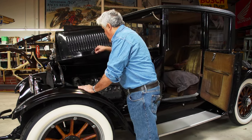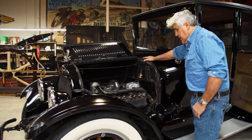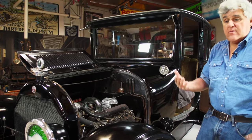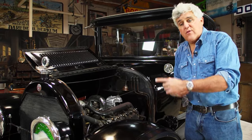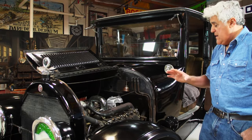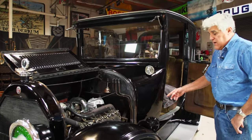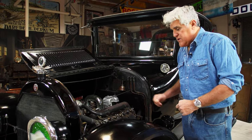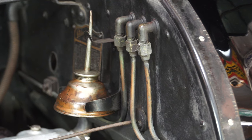Let's take a look at the engine. It is a beautifully manufactured V8 — it looks a little rough because it has not been restored. It has detachable heads, three main bearings, and two water pumps, which is kind of interesting. Most cars of this period had thermosiphon cooling like the Model T, where water got hot and rose and circulated — not an efficient way to cool. This had not one but two water pumps, and even has a compressor at the end of the transmission. If you get a flat tire, you engage the compressor and pump up all four tires.